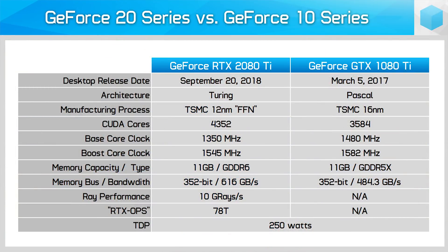With 10 series laptops, even the most chunky beasts topped out at fully-fledged GTX 1080s, as that was the highest standard laptop GPU NVIDIA provided. The GTX 1080 on the desktop had a TDP of 180 watts, which pushed down to around 150 watts for laptops, whereas the GTX 1080 Ti had a 250-watt TDP and there was no laptop equivalent. So with the RTX 2080 Ti also packing a 250-watt TDP, we're almost certainly not going to see it in laptops.